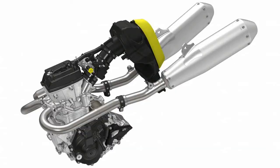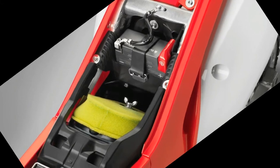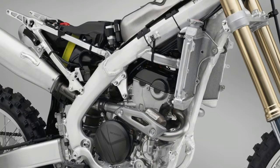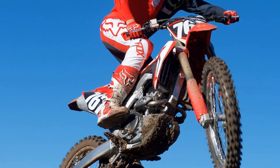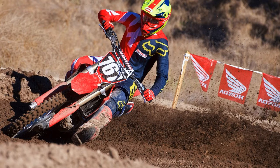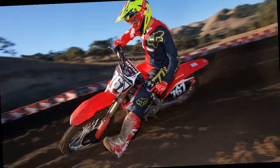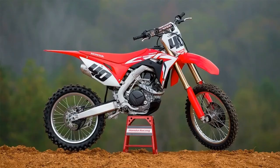Suspension. The new Showa 49mm spring fork is a tremendous improvement over the previous Showa SFF TAC fork. The new spring unit offers a fine balance between comfort and performance feel. With the stock suspension settings, the bike wanted to stand up in rutted corners and the front end seemed to wash out in flat corners occasionally, so the Honda technicians raised the fork 1mm up in the clamps, which helped the front end hook up better and not tend to wash out as much on the flat corners.